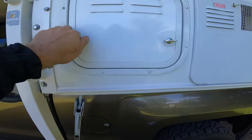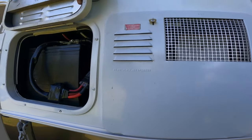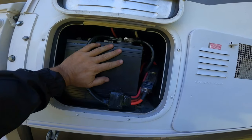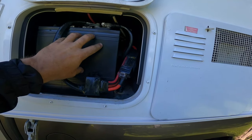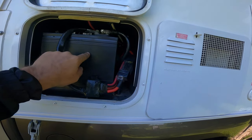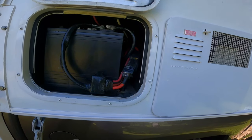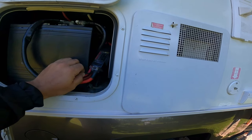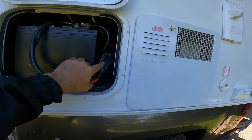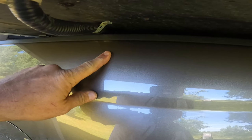Let's talk about power. I'm running two six-volt Crown batteries, mounted where the factory batteries would have been, but I took the sliding tray out to fit these larger batteries. These are 230 amp-hour batteries and I'm charging them off the truck's wiring. Normally that would be through the trailer wiring harness with 10-gauge wire, but I'm running a number two wire with a 175-amp fuse that connects in the bed of the truck with an Anderson plug.